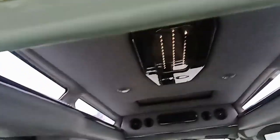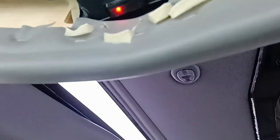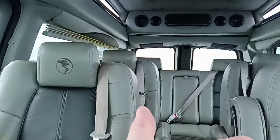Now I'll show you the back side of it, and this is what you get up front by where you sit, and these are all the connections for your television. There's your HDMI input there. There's all your component inputs, your power. All of that is right there in the split. All right. So if I had that trim piece back here removed, I could take that panel and walk it back, open it up, do anything I wanted to the back of the TV, and then put it back in place. All you need is a Phillips head screwdriver.